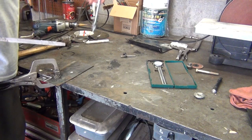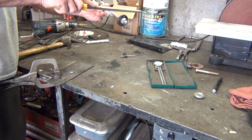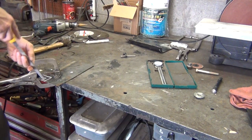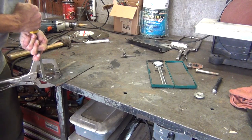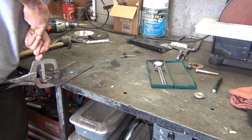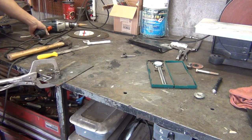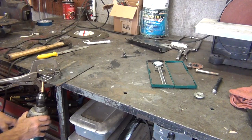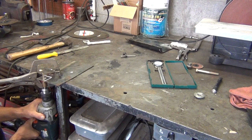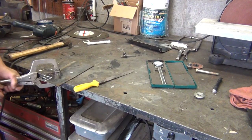A lot of times they stick a bolt in a lathe or something and just lay this on here and as the piece turns, you just kind of follow the threads and it cleans up the threads if they get burred up or something. But I'm going to use it to make a square hole. And this works pretty good. Before I do that, I'm going to go through the bottom side. The step drill doesn't quite break through. There we go. That'll be a little bit. I'm going to get this closer to the edge too.